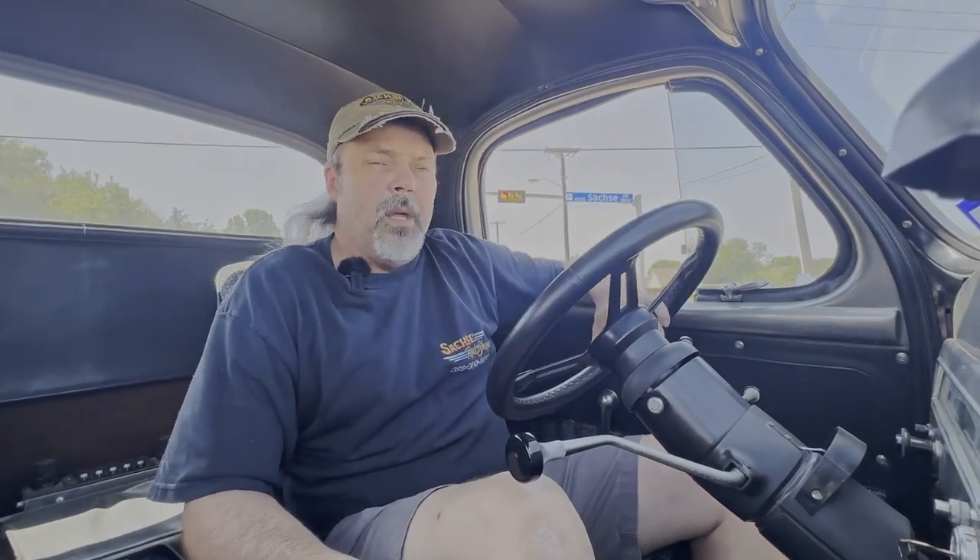In doing that, we were able to run a Chevrolet engine. It's got a turbo 400 transmission. It also has a Chevrolet truck power steering box and Chevrolet truck long tube headers on it that have been on it since '77. Out back in the rear end, it's got a 1956 Oldsmobile rear end — I think this thing's got 3.23 gears in it.